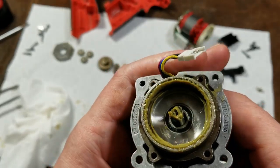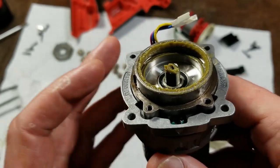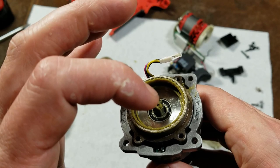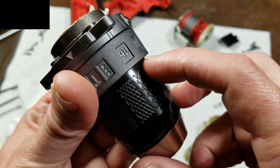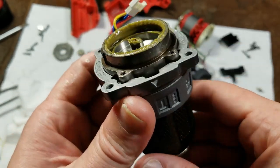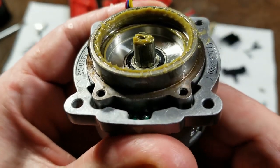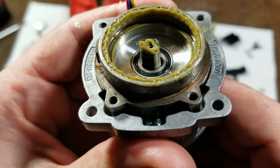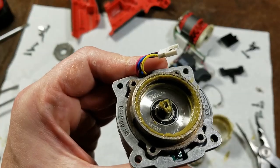They use a trilobed drive pinion design, which is pretty good. Getting chucks on and off from the factory requires a special socket, so if you ever have a really stubborn chuck you often have to take it apart down to this point to get hold of it. There's a rubber sealed ball bearing back there and I assume a second one just a little further up for support. Interestingly, there is some kind of snapping in here that prevents it from completely falling out. In hammer drill mode you're pressing against little dog teeth, which is why there's always a little bit of spindle play — it has to slide back and forth inside the bearing.